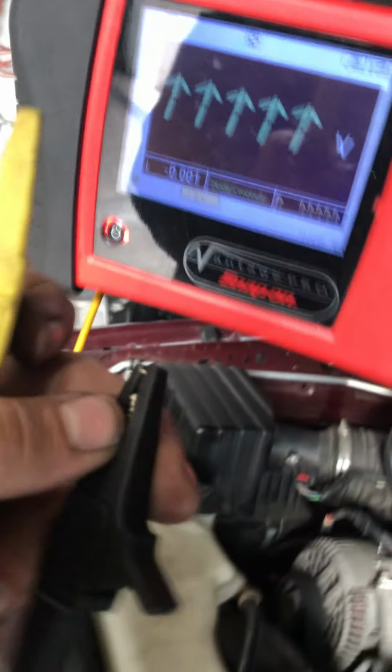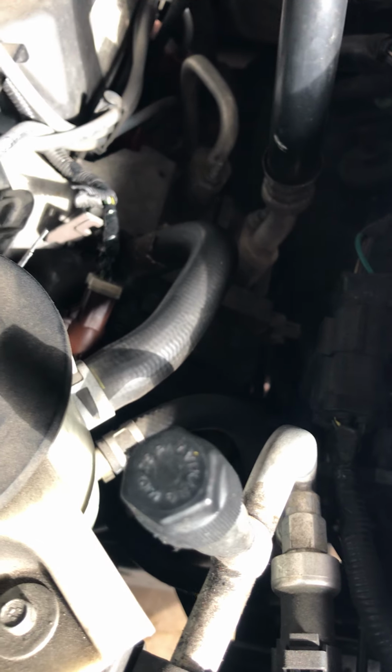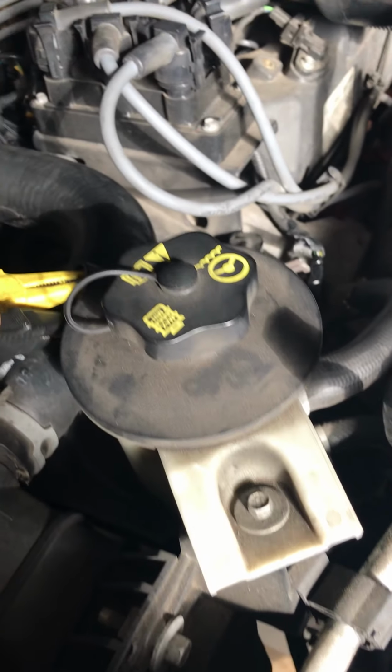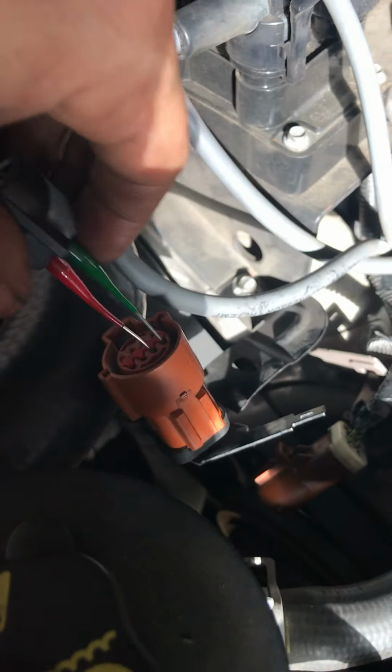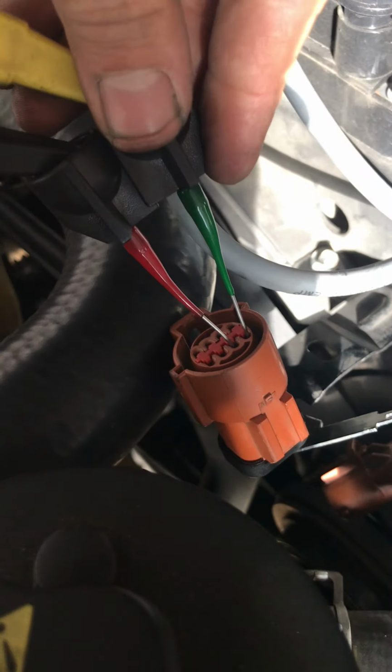Now let's go calibrate. If you hear that noise, that's indicating that it's a closed circuit. The moment they come off from one another, it doesn't make that sound anymore. So if I connect this right here and this right here, it should make a sound. It feels there's continuity. No continuity. Let's see that harness. Harness is right there. I'm not making any continuity. Now, well, let's go check that first circuit. The first circuit that I already know that did pass its test. So no continuity, no sound there.